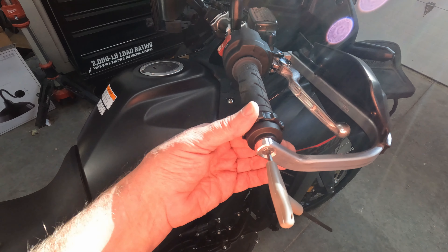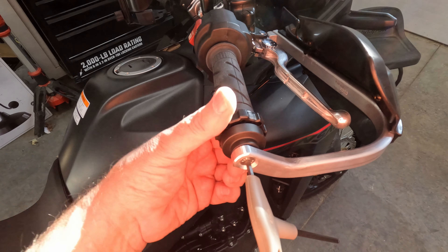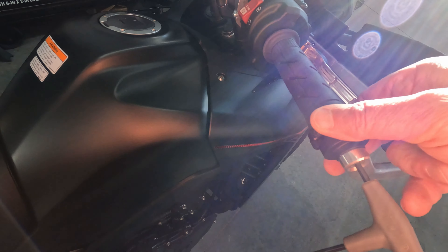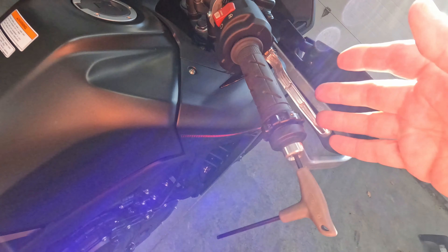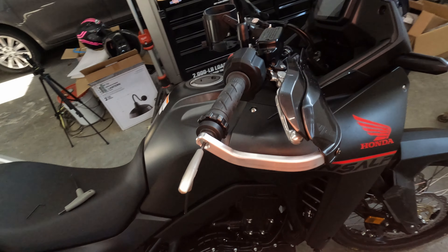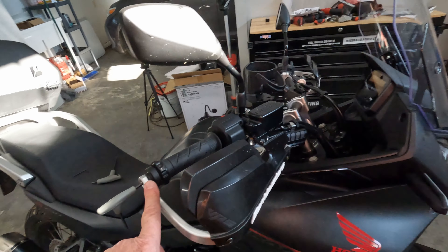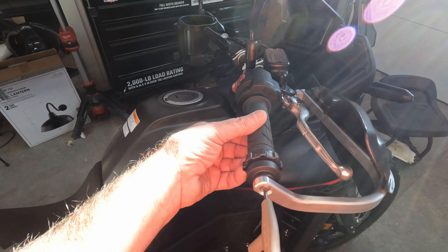When you snug it up against it — does this drag? How much does it take? Oh, check that out, and then you just back it off. That's amazing. Now I'll just test this dude out on the road. So there you have it — if you use the Bark Busters for the Kaoko throttle stop, throttle lock, cruise control. They call it cruise control on the website, but I don't know if it controls their cruise; it just keeps a certain speed.